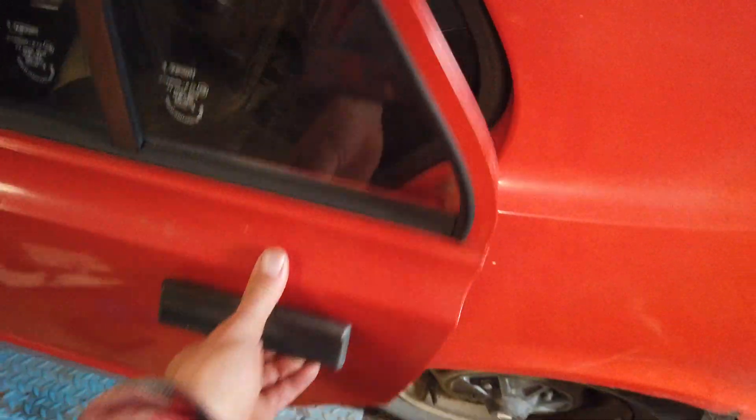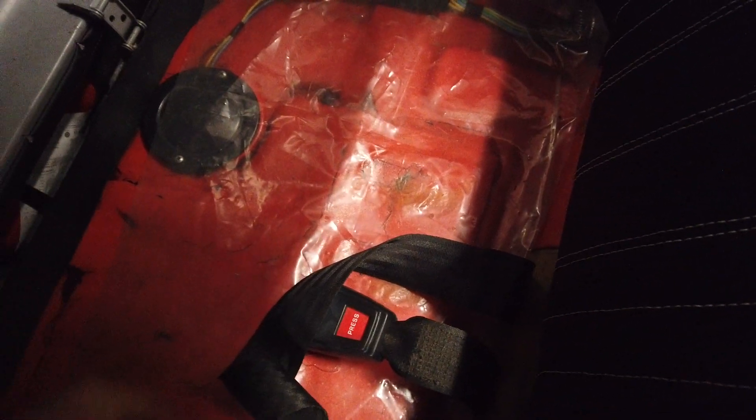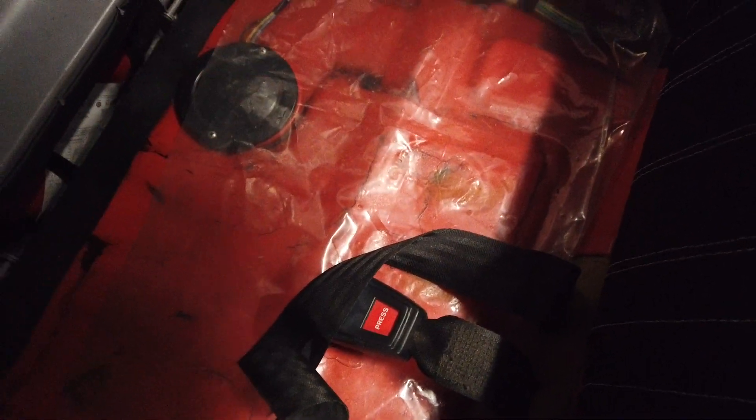So let's get to work. The fuel gauge lies behind the seats — well, not really here, but most likely under here, right underneath this hatch. But before doing anything else, I'm gonna disconnect the battery, just as a safety thing, because there is wires and there is fuel. Those things should be combined very carefully.